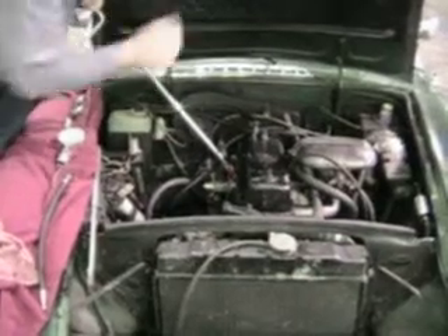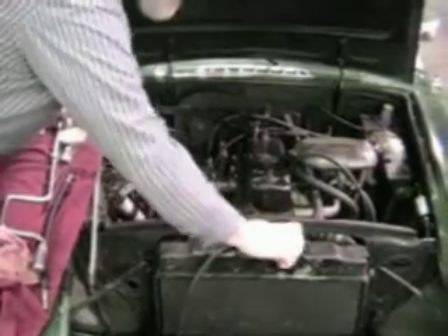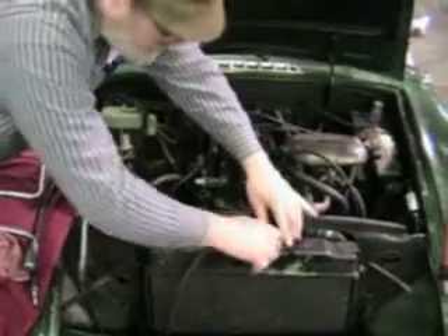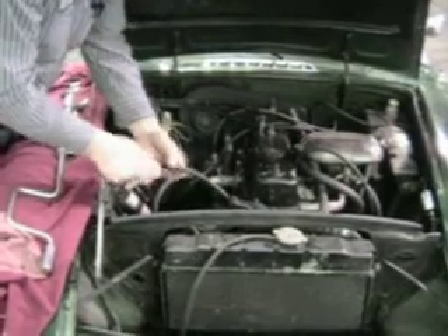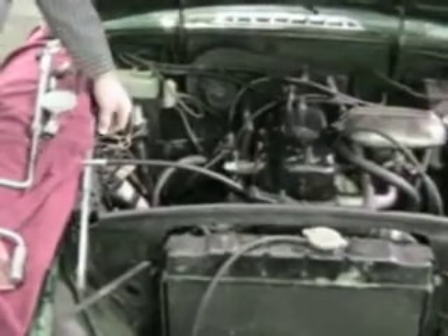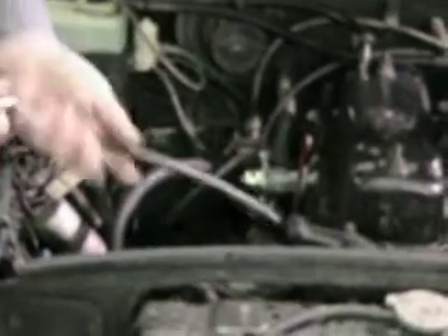That isn't uncommon at all. And although you can't hear it, I can hear the top of the radiator gurgling here, so we've got some sort of problem with our radiator cap or something here. All right, so here we have our tube — we're going to put this in our number one. Now remember, we took all the spark plugs out, and we want to make sure the car's out of gear, which it is. We take our white with brown wire — that's been our most commented video. So we can spin the engine over and we're going to put our compression gauge on it and go ahead and check the compression.